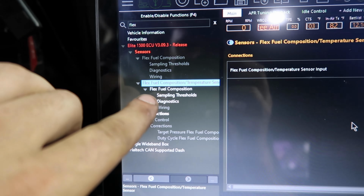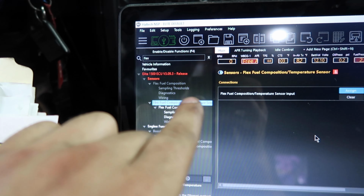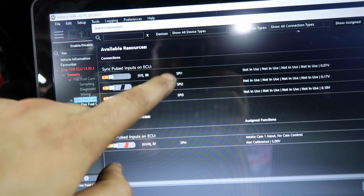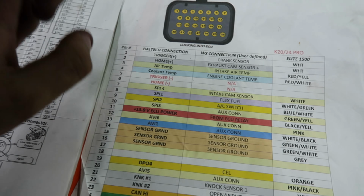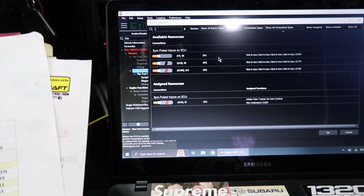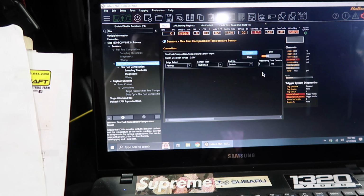So if we go into the ECU, flex fuel composition slash temperature sensor, because the Haltech also is a fuel temperature sensor. We go to assign the wire for the signal wire, and we have three pull up, SP1, SP2, SP3. And if we go to my pre-terminated harness that I got from Wiring Specialties, not a sponsor, we can see that flex fuel goes to SP1. So click on SP1 right here. Okay. And it is now assigned.